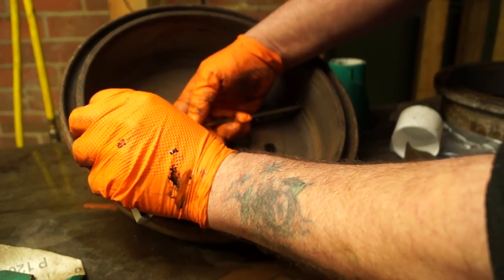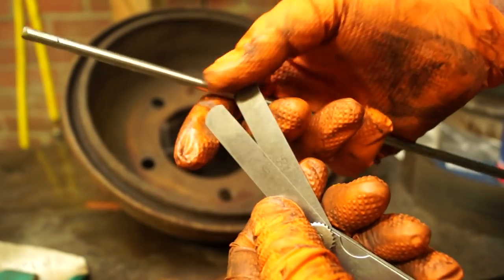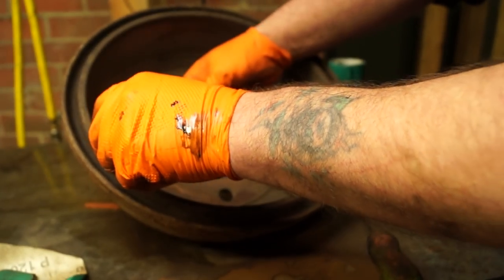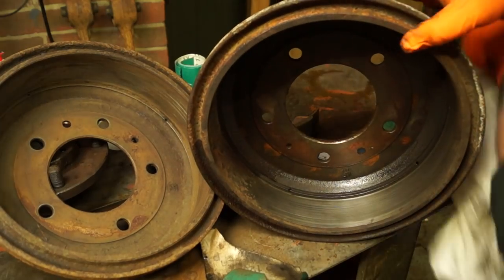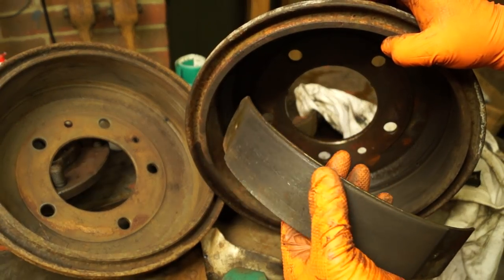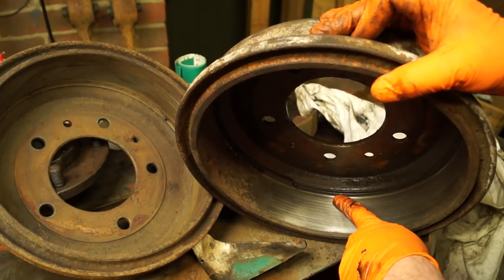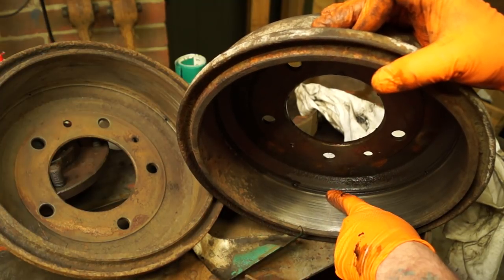The rod I made up here measures at 287.3mm. I've got a millimeter of wear, and if you skim out one millimeter that opens it out by two mil, so there is an option to skim this out. On the other side, however, it's in better condition — you can see light scoring. The shoe will tell you the story of what condition the drum is in. The working surface is okay, but I'm feeling the surface is actually raised, so it's lower in the worn areas.